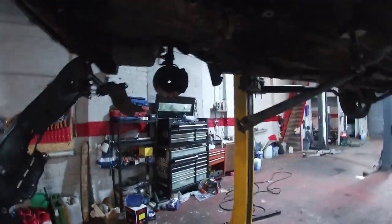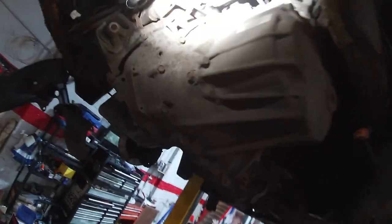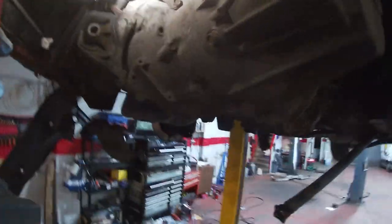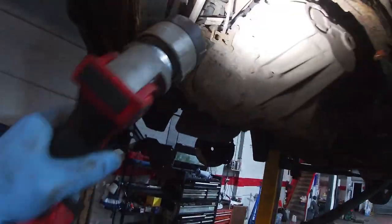So that's where we're at with this one guys, so we're not far away at all. I've got the sleeve to unbolt. Looks like there's a wee cover over that as well. So we've got the sleeve to unbolt, two bolts up there. I think we've got all the bolts out of the top. I'll put it back down and double check. I know I've got that one, definitely. I think I've got the bolts out for up the top. So I'm not too far away. We'll get hopefully a bolt going that way for the starter. Oh no. So two of them are in that way then. Yeah, okay, hopefully we can get to them. If we didn't get to them, we'll figure that out in a minute. Hopefully it's underneath that wire in there. I just can't see it.